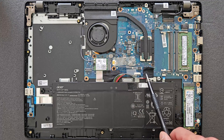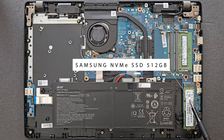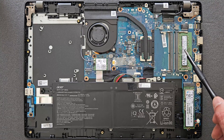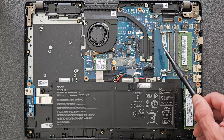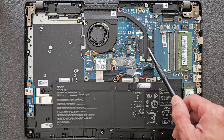Before you start upgrading, I recommend disconnecting the battery first. That's your solid state drive — at the moment there's a 512GB in it, and we're going to upgrade that to one terabyte. RAM is also upgradable — great news. At the moment there's an 8GB stick in it; we'll upgrade that later. The second RAM slot is empty at the moment, so great news with this laptop. I'm quite happy and surprised — two RAM slots! And that's your CPU.